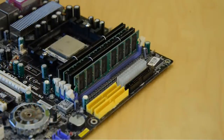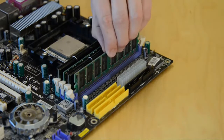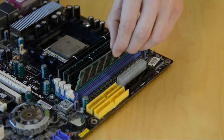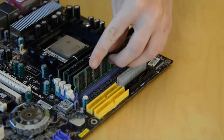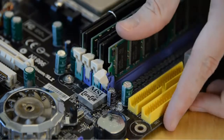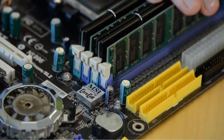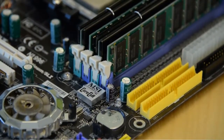Next, take a look at RAM. We recommend buying a motherboard that can accommodate at least 16 gigabytes, even if you don't plan to buy that much initially. Also, look for a board that offers four or more memory slots — that means you can install two RAM modules initially, and you'll have room left over for memory upgrades in the future.